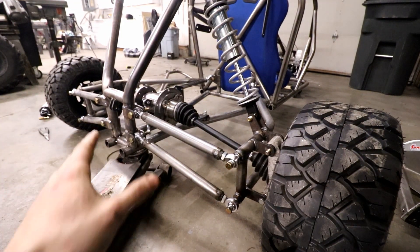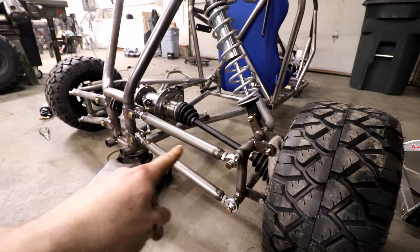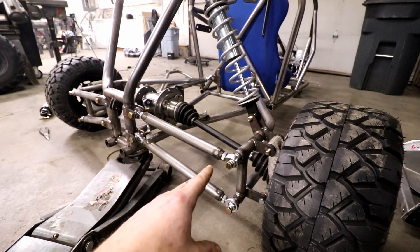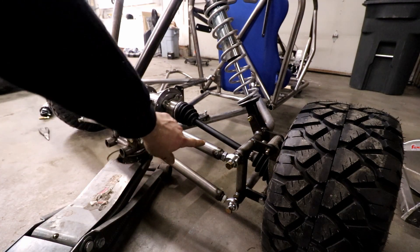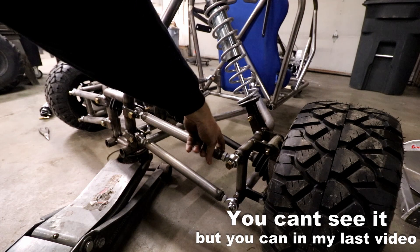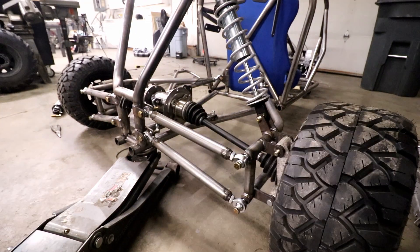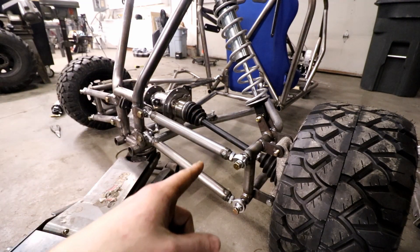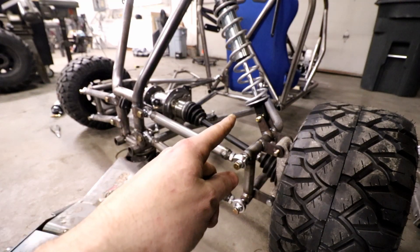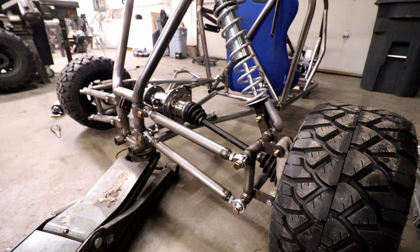Lastly, possibly, is all the hardware and tube that you use here. I've used inch and a quarter 095 for all of the tube down here, and then I've used hardened chromoly heim joints — you don't want to cheap out on the heim joints. If you can see this spot here, I've welded in the threaded inserts for the heim joints, and then I drilled out spots on the sides of this tube so I could plug weld. So those inserts are very strong and that's not going to be a weak point. These are five eighths inch heim joints here in the rear since there's so many of them, and then the single one in the front is a three quarter inch heim joint. I'm pretty sure that should all be strong enough, but we will see through all the abuse I put this thing through.